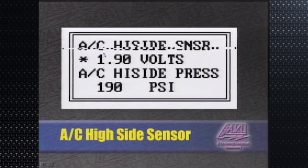And you can see, basically, it's a one-to-one ratio. We're showing you here in this example that when the AC pressure sensor is running 1.9 volts, that's 190 PSI — in other words, 1.9 volts equals basically 190 PSI. If you had 2 volts on the AC high pressure sensor, that's 200 PSI. For example, 2.4 volts equals 240 PSI. So you can see it's a proportional ratio that you can correlate AC pressure voltage to the actual pressure value of that system.